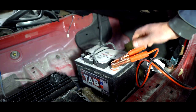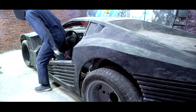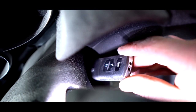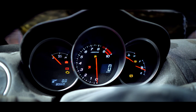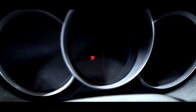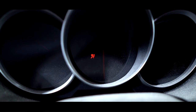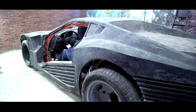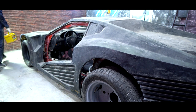While removing the racks, I immediately thought about the energy storage device and removed the wires to the cabin for it. It seemed no new errors appeared on the dashboard, only the airbag icon flashed as I took them off with the cabin. Tried to start the car but something went wrong. Most likely because of the downtime it discharged a little. I already know from my own experience that this rotor doesn't like discharged batteries, so it needs to be changed for a charged one.